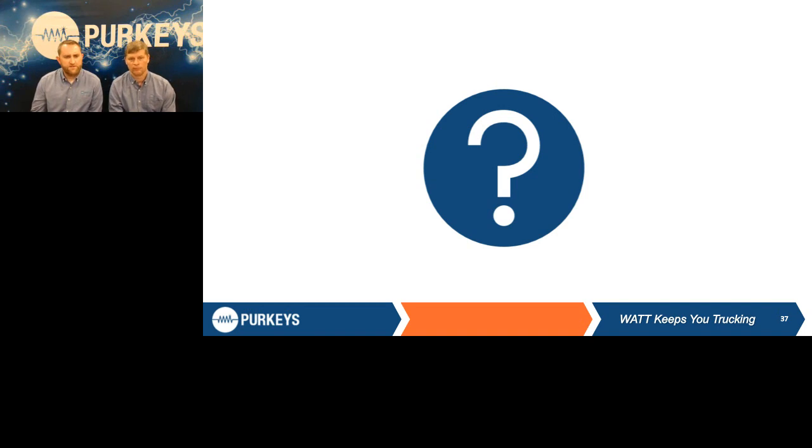Question: if the label is missing, but you know the amperage needs of the truck, couldn't you load test it to that and determine if it meets the truck's needs? Technically yes, but that would really be a hand-grenade approach. Say they were 950 CCAs and you only load tested them as a 600 — did it meet the requirements? Yes, but that battery has lost so much material and capacity that you're setting yourself up for a road call. I would not feel comfortable trying to make an assumption about what those batteries are and load testing them that way.